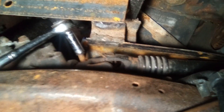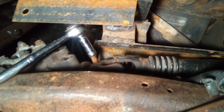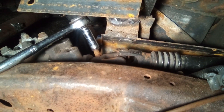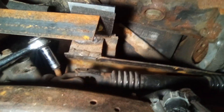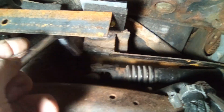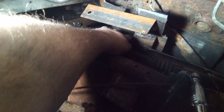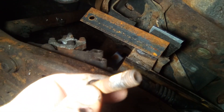Alright, more fun. This time I'm on the steering shaft, the bottom half of it. I'm going to get that out of there. I think I've got to take that bolt the whole way out because I think there's a little ridge or a groove cut around there that it fits into and it won't come off without taking the bolt all the way out. So it's rusty, but I got her loose. I'll probably still have to bang on it or something with this BFH to get it to remove.